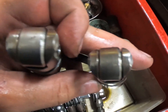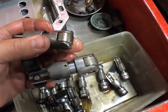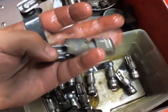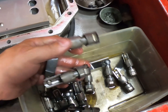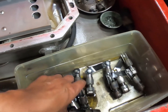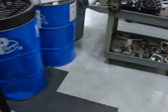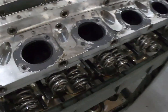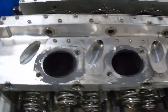And when we did that, it blew up one lifter. And I see that it has damaged a couple other lifters. A couple others just don't roll real well. And pulling them out of the lifter bore, a little bit tight pulling them out, which means that this area right here gets a little wide from getting swedged out, but that's mainly because I think we broke 3 valve springs, and I think it was all just solely from that rust. So we put these new valve springs on it, and been making other passes on it. Those other couple for that next test session, and just couldn't get the thing sorted out.